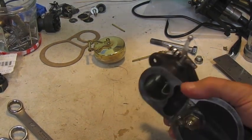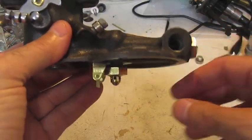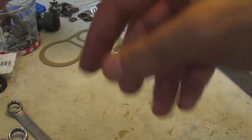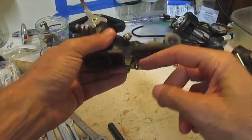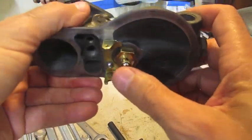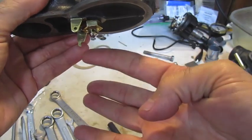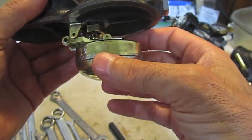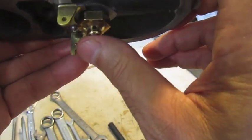For leaks, let's start with the fuel coming in. The fuel line comes in here, and there's a valve where the fuel enters the carburetor. The fuel comes through underneath — that is the float valve, because the float touches there. There's a little ball here, and when the float is floating in the gas in the carburetor and pushing up against that little ball, it should — if properly sealed — shut off the gas flow.